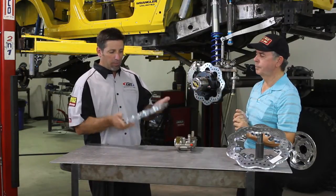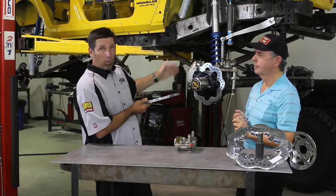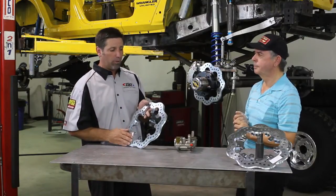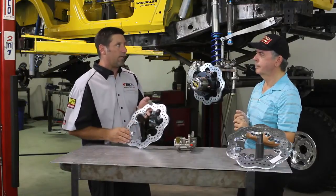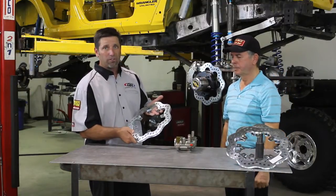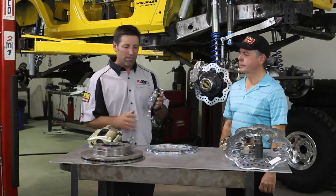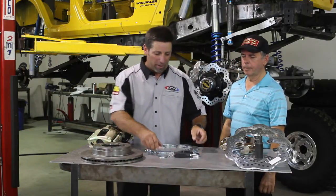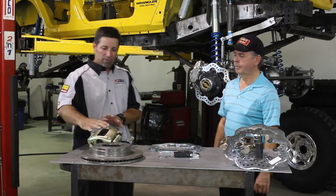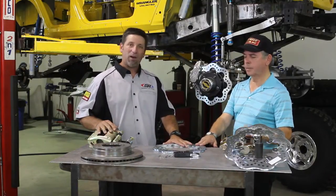Once the material goes back on a high-performance car or race car and you put it through massive heat cycles, it's not going to warp again — it's going to stay consistent with better wear characteristics. He's also done a lot of work to keep the rotor light. We grabbed our digital scale, and you might already assume this would be much lighter: you're looking at almost 40 pounds for a stock setup versus eleven pounds six ounces for the wave rotor setup.